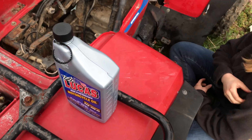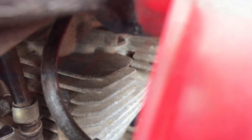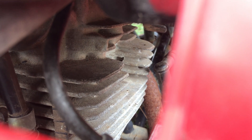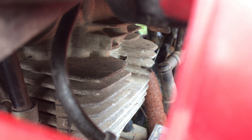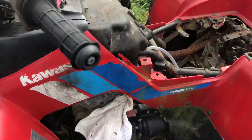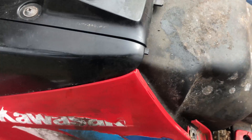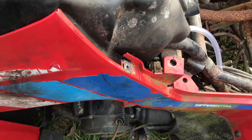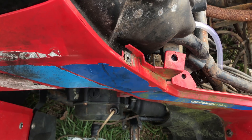Where's the new one? Before we put the new one in, it's been a long time since this has cranked over, so this is a little bit of penetrating oil. Go ahead and squeeze some down into that spark plug hole. Not too much. How much do you think you put in there? Do a little bit more. You want like maybe a tablespoon. Now with fresh oil in here, and now we just put some penetrating oil — so we were just lubing that piston up a little bit.